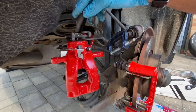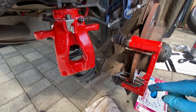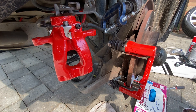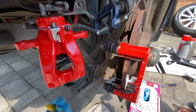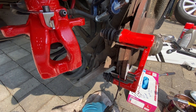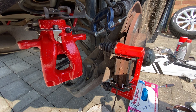With that tightened up, I've just stuck a screwdriver through the hole so we can hang the caliper on there. What we're going to do now is just get a bit of copper grease in the sliders, ready for the pads to go in. Next up I'm just going to get the pads in - I'll go with the back one first, which is the one with the pad and the plate - just click that in and then the other one as well. Sometimes it's easy to go in at a little bit of an angle first and then just twist it back in.